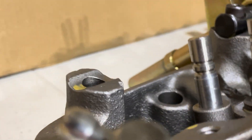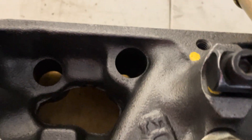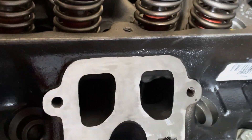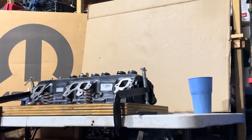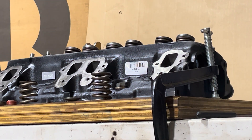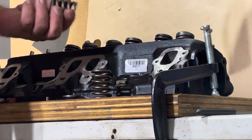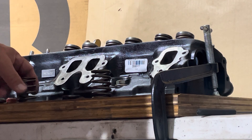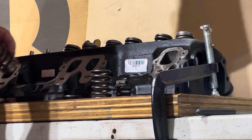It's pretty much set and good to go. I was running through the heads — you can see the very large push rod holes, because this was on roller motors. I was going to check valve spring heights, but I don't have a valve height checker that's small enough. I need one for the stock valve spring height. These are pretty small; my smallest one goes to just under 1.6, and that's about what these are.